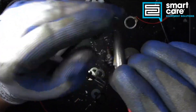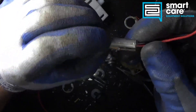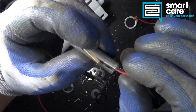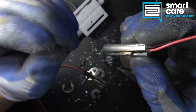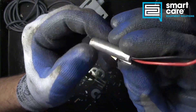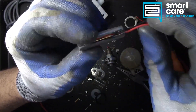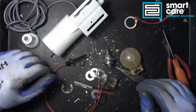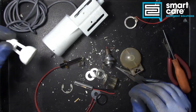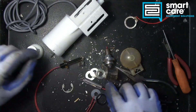The reason there's glass in there is because moving electrical current across open air creates an arc. If you put glass around it and fill that glass with an inert gas like nitrogen or argon, that arc doesn't oxidize — it doesn't create that big black charring. The other reason in this case is probably just so the epoxy doesn't get into it. So we ended up with two different style switches: the Hall effect magnetic switches and a reed switch inside the dish machine float.